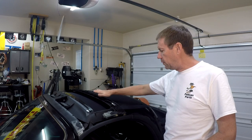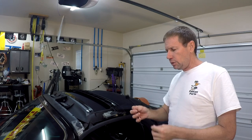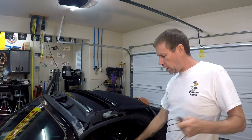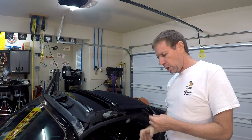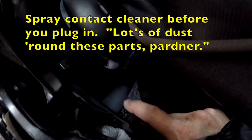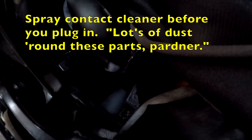While we're waiting for this piece to finish curing and the paint to dry, we're going to install the wiring harness for the defrost cable. The harness has a single plug, a short cable going to the left side of the window, and a longer one to the right side. We'll plug that in behind the driver's seat — there's a little panel, pull that lever up, flip it out of the way, and that's where the plug goes.